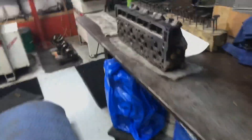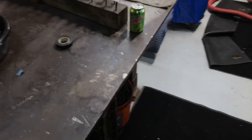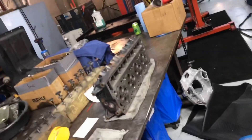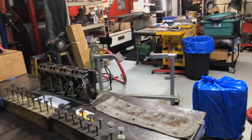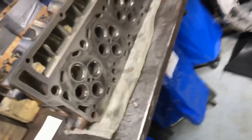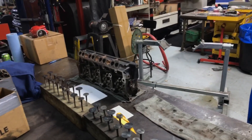Okay, cylinder heads. This thing did run good — valve recession was honestly pretty good. A couple of them were real tight at 13 thousandths, which gives a lot of compression. The cylinder heads with the valve job contributed heavily to how this ran. They surfaced them, and whether or not it was intentional — with recession at 13 to 17 thousandths max, that builds some serious compression. We need two guides I think, since they haven't put guides in, and we're debating whether to put a full set of guides in and do the full valve job.